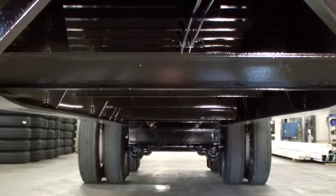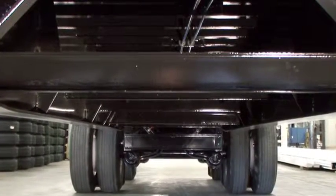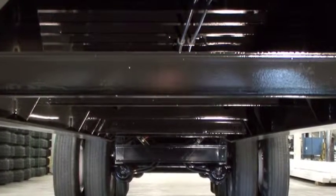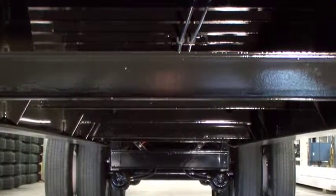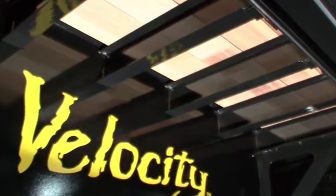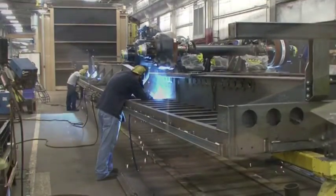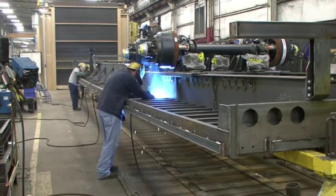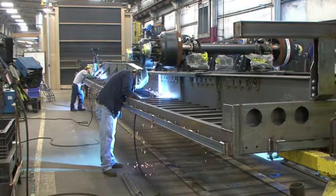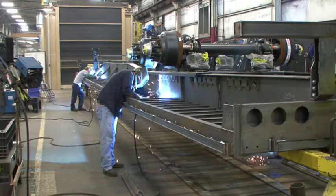Additional 4-inch steel junior I-beams are strategically positioned and welded between the main beams near the lower flanges and in line with the outer side rail braces. This alignment allows for the proper transfer of loads from the outer rails back into the main frame. Unlike some manufacturers, the cross members on the Velocity are full length 4-inch steel junior I-beams positioned on 12-inch centers for greater floor support. They are securely attached to the main beams and side rails with full welds on both the front and back side of each for optimal strength.